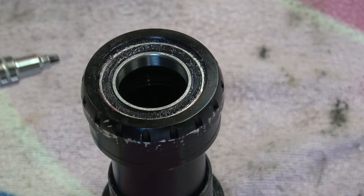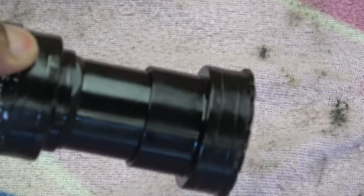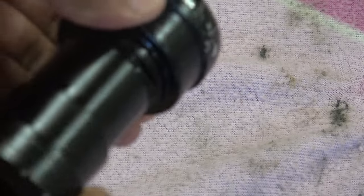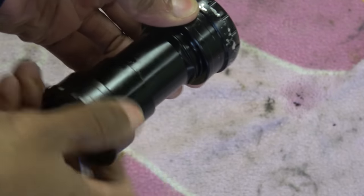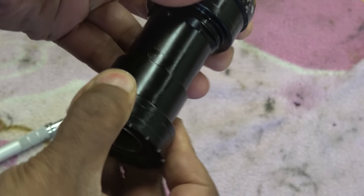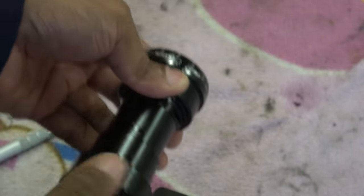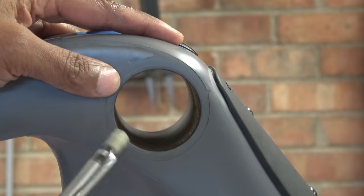This is it zoomed in. The chap said he couldn't hardly rotate the non-drive side bearing around — it was literally ratcheting around. There's hardly any damage there, but then there — look at that, it's horrible. Underrotation everywhere. This is a close-up of the bottom bracket — the BBB bottom bracket designed for BBright. It is thread-together, so it's not reliant on the press fit interfaces for retention, it's literally screwed in. Now the problem with that is about to become fairly obvious. Even at the right dimension, there's a bit of play in there, and you can hear the play.